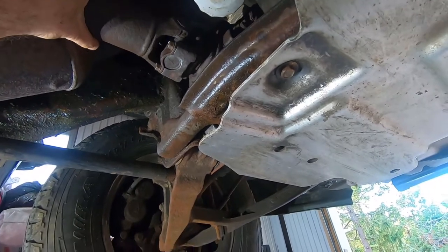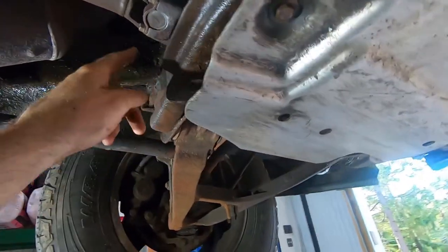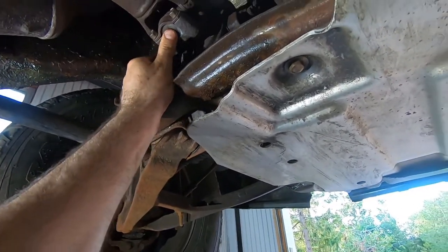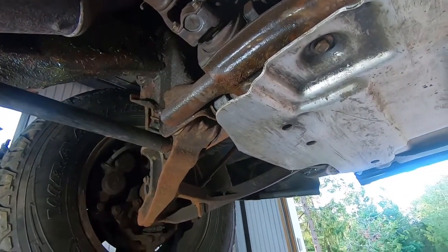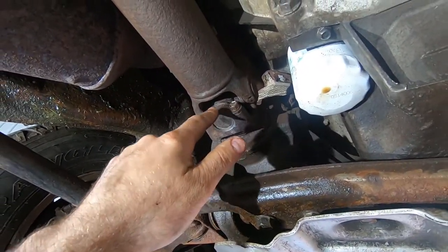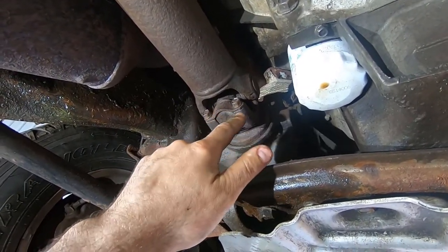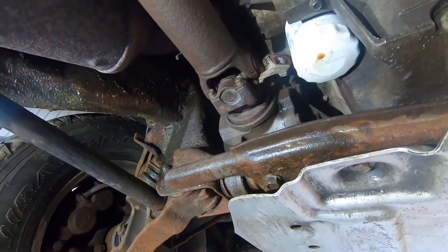I haven't got personal experience with it, but what I find bizarre is the other side is tight — so why is this one loose? I'll check if these bolts have backed off, but I'm doubtful. That means corrosion has allowed space to open up and made this loose. My options are: replace the straps for ten bucks — which I did buy — or take this strap, clamp it in a vise to straighten it out a little so that when it bolts down it grips better.